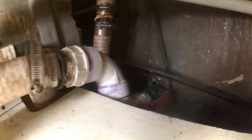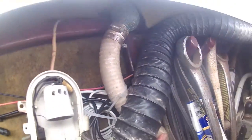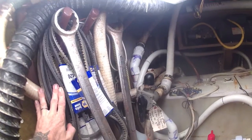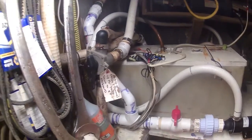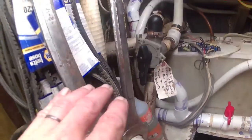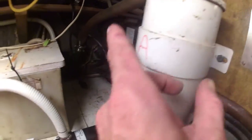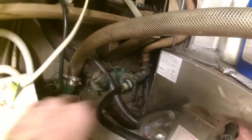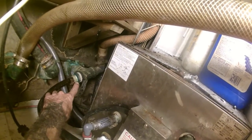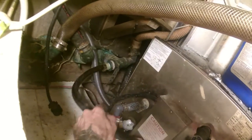Some other recent work — this set of 90s right here is going down to a valve on the through-hull there, with a nice ball valve. And this is a cockpit drain — a recent reroute. The cockpit drain had come from here and ran down, kind of over and up and around into a through-hull right there where my finger is pointing. I've changed it around now. That's now a bilge pump discharge there.